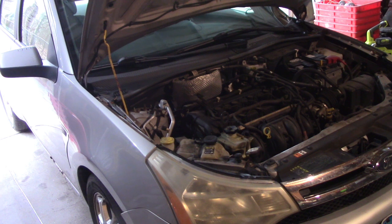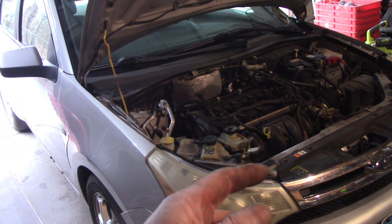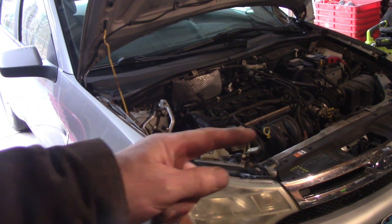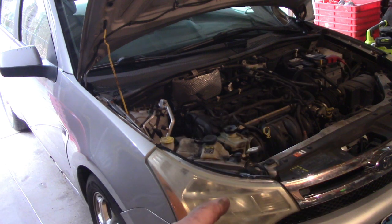I can't get it to leak without getting some heat involved on the road, so I'm going to put some pressure on it. I felt the heater hose, which I was a little concerned about because this is one of those hoses that starts over here and snakes around and tees off and ends up in east Kentucky. It is not the upper or lower radiator hose - the upper is dry as well. We've got to figure this out because he said there's a puddle, and a guy at Napa also agreed it was the bottom radiator hose, but I don't think so.